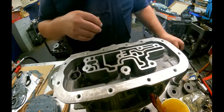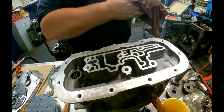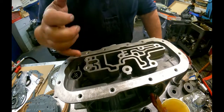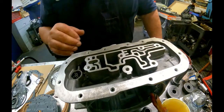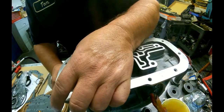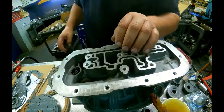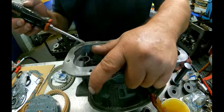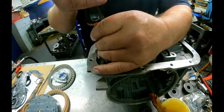We can go ahead and put our valve body and our pan on because we don't need it. This is a BMW. We'd have to wait till we put this on the case because the wires come through here for here. We can take this out and we can silicone this. These tabs usually break, so I don't even try to not break them. I just knock it out.